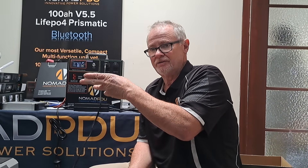Read all the instructions when you get them, including those for the chargers. The chargers themselves should always be charged directly to the power plug in the house or wall — try not to use power boards to connect the charger. It's better to have a direct connection to the wall. If you're connecting through power boards, that can sometimes cause interference and a buzzing noise. It's not going to hurt it, but you will get questions as to why it's doing that, and that's typically because of what technologies are in the power board.